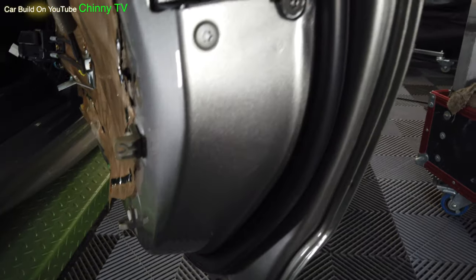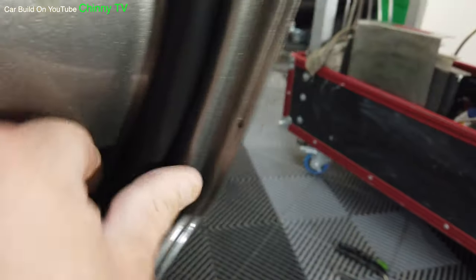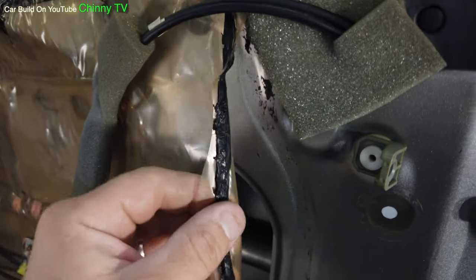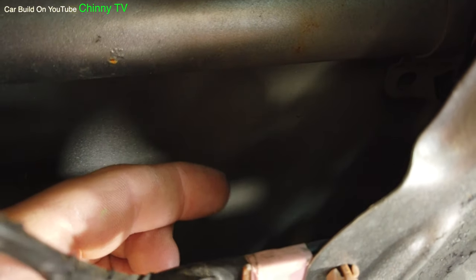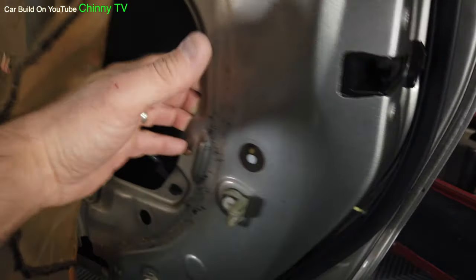On to the next one — number two dent. How are we going to get to this one? We've still got this rubber trim, so it's got to be attached somehow, and it is — another little clip. Take the clip out and there's a hole there, so we can get right onto this dent. Thing is, it is quite a small hole, so if you start putting a bar through there you're going to start breaking the paint. So for the little extra effort, you can take the door card off. We've got this membrane — quite brittle because it's quite a few years old — but it looks to be in good condition, so we don't really want to start ripping this because it's there for a reason. Carefully pull this out of the way and get all the way inside, and the dent is down there. I think we're going to use this way of getting in instead of the little hole for this one.